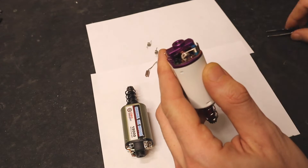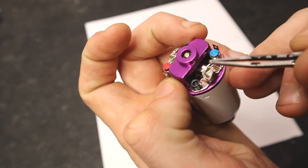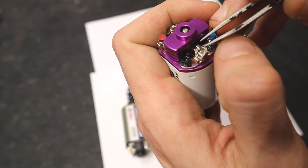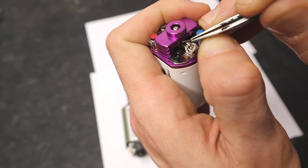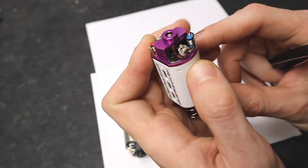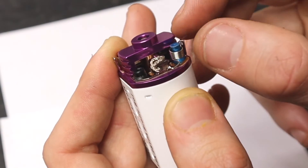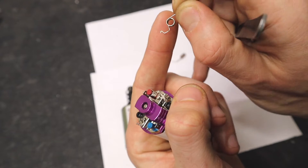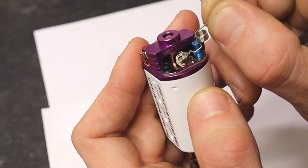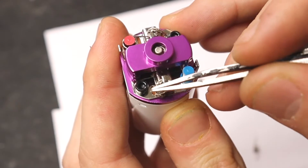The first thing you want to do is release the tension on your spring. The way this is set up, there's a little metal flap right here that holds the spring, and the spring holds the brush. Push up and the spring will release. At the bottom of the spring there's like a little arrow, and that little arrow points directly into the butt crack of the brush.